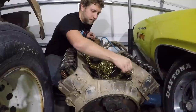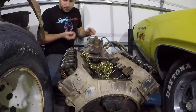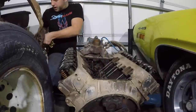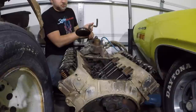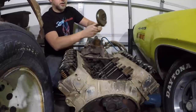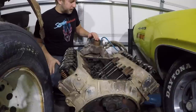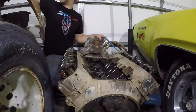I got a nice fancy mic for my GoPro, pretty happy about that. Just taking this chain off. I apologize — I can't get you guys at a better angle. As you can tell, I've got a whole lot of room to work with here. Our oil pickup looks like garbage — there's a bunch of giant dings and dents in it, they're pretty sharp, and I can hear stuff rattling around in it. Looks like confetti. You can see all the scraps of metal sitting right there in the screen. In order to get these heads off, we're going to have to pull the water pump off. Let's see what kind of tools we've got here.